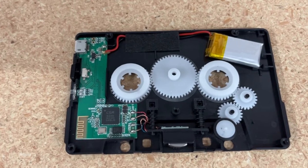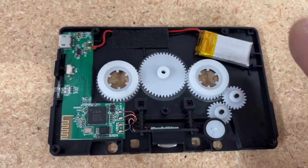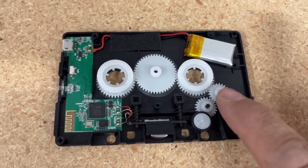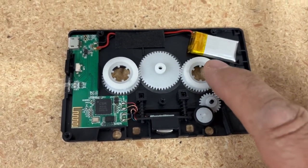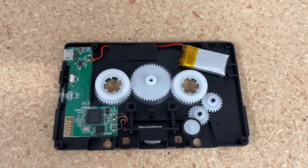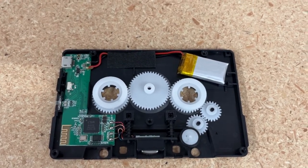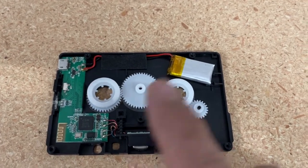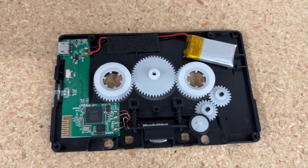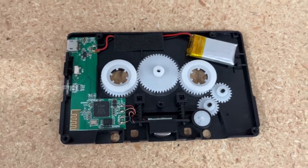The real noisy part is that these gears are not very well lubricated and they move around a bit — that's just why they're loud. So if you put some petroleum jelly on these things, some kind of thicker lubrication, I think that'll keep the sound less, and that's what I'm going to do. Technically, these wheels don't even need to be in here, so you could probably take out all of these gears and it'll still work, because they don't serve any purpose in transmitting the Bluetooth signal. It's more of trying to mimic the tension of having an actual tape in there.